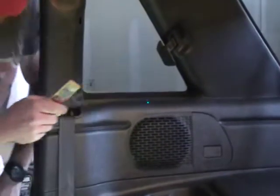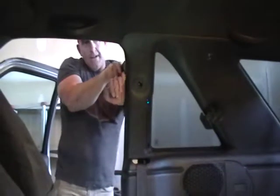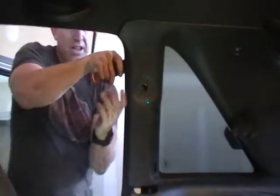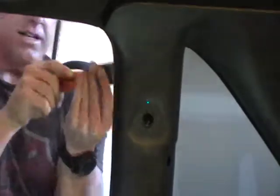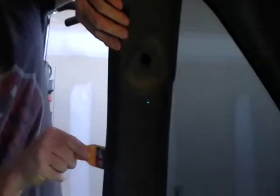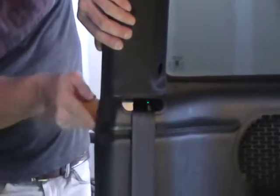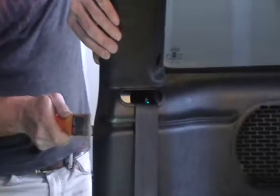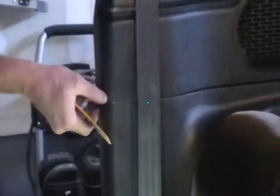You do need to crack this window. We've got our putty knife — you can just start here at the top and try to basically get it behind the panel and just give it a little pop. Once that starts getting loose, you just work yourself down until you find another body retainer. Pop it loose, and those should come apart fairly easily.